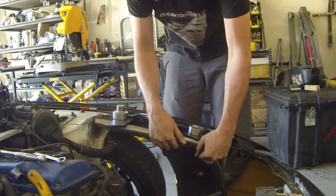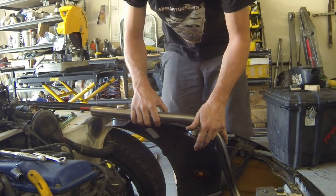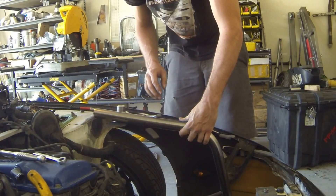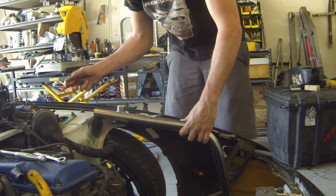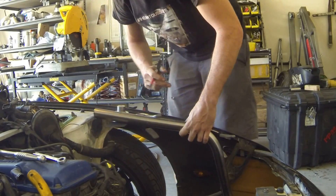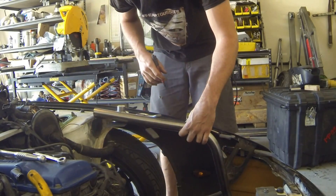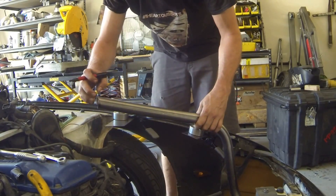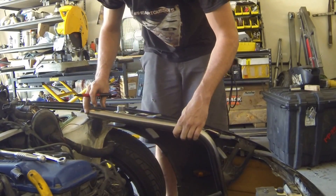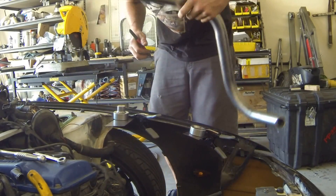Undercutting is always a good thing — I still have to trim back probably about a half an inch to get it lined up at the bottom where I want it. I can't hold these dimple dies in place underneath, so I'm going to mark the chassis about where I need the tube to land — just go to the center of the tube and make a reference line. That way when I stick it underneath the sheet metal and place it up top, I know exactly where the center of that tube needs to land without having the dimple dies in place. Now I'm going to trim this back just a little bit each time — a little bit more — until it lands where it needs to be, which is only about a half inch or so since I undercut it before.